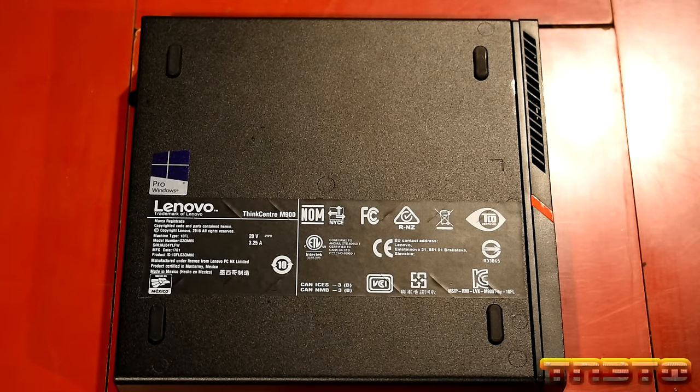And you have F12 to choose a different boot option, and you have Control P to enter your Intel AMT for your Intel vPro, okay, which we will want to go into later, factory reset it, and then get it configured for our specific configuration. So I'll go into the BIOS and check some additional things in there, but I also want to diagnose hardware. So let's go ahead and go to that really quick. So that's F10. I want to show you guys what that looks like.